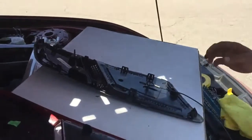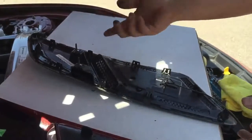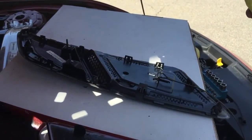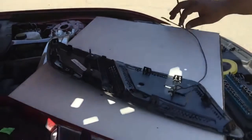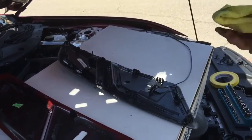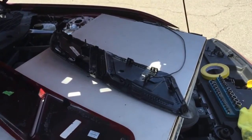What you're gonna do next is, once you did the window weld, you're gonna let it sit, you know, on a sunny day, half an hour. Let it sit half an hour so it doesn't separate when you install it. If it's cold out, or you want to make sure, an hour or two will be fine. You want to put them in your house. So we're gonna let this sit and we'll install it a little later.